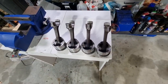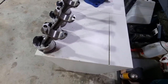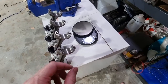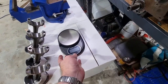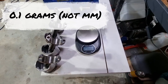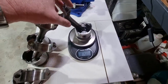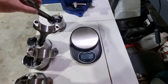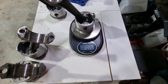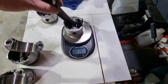Next thing to do: I've got some ARP rod bolts coming. When I get those, I've got a set of really accurate digital scales. An assembly like this — including the big end cap and bolts — is roughly a kilo, and the scale reads to 0.1 gram. Just to give you an idea: one assembly is 827.9 grams, and the next is 845 grams. That's 18 grams difference just in those two assemblies. The exercise will be to balance them all.